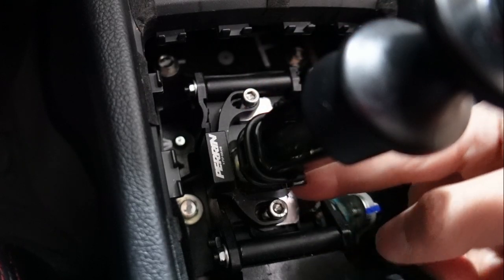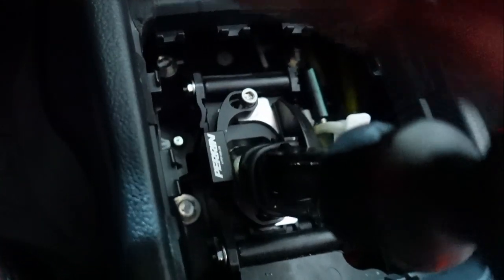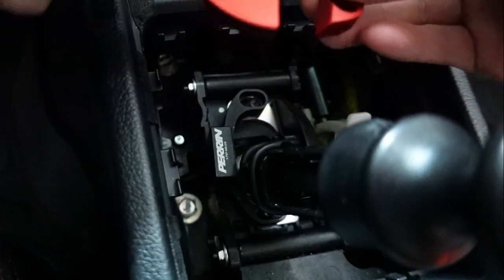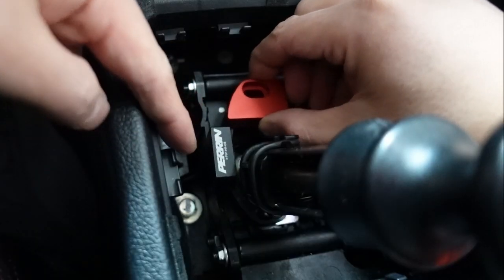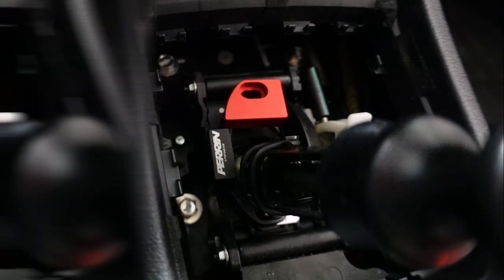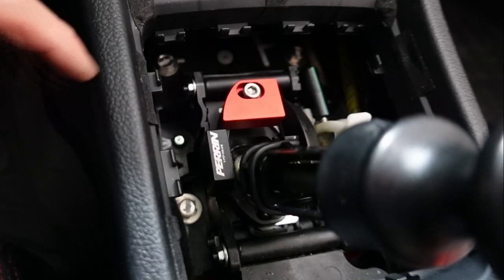After you get the tabs removed from the front and back section, the next step is to remove the bolt right here. In order to retain the position of your Perrin shifter stop, you want to do this one side at a time — we'll start with the front one. Go ahead and remove that Allen bolt. Then grab the bigger piece out of the two — we want this one for the front. Place it in there, and be very careful not to drop anything in here, as you can have yourself a bad day if that happens. Now use the supplied bolt and carefully tighten it to around 10 foot-pounds, just a little past hand tight.